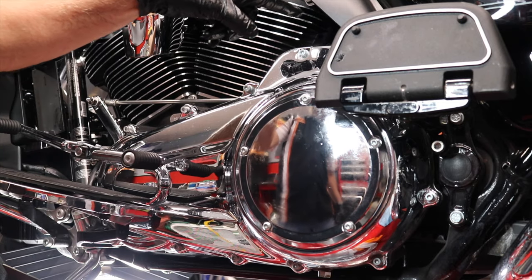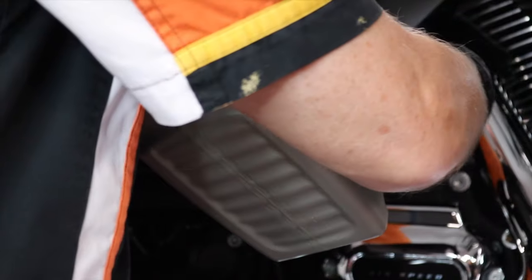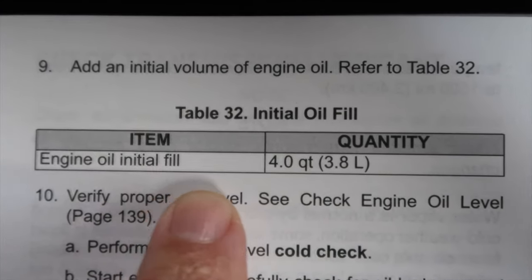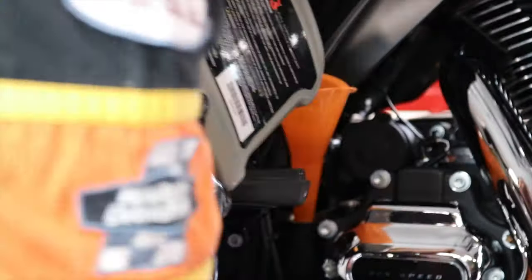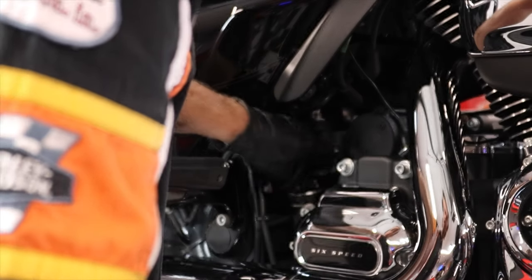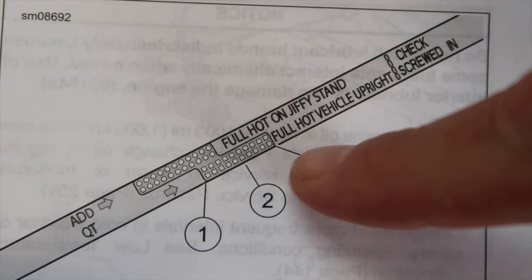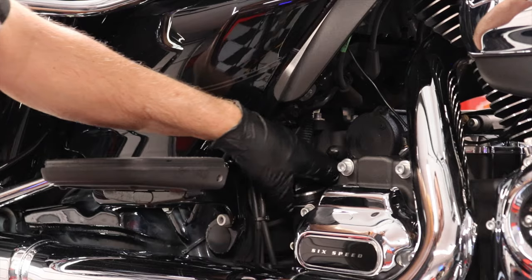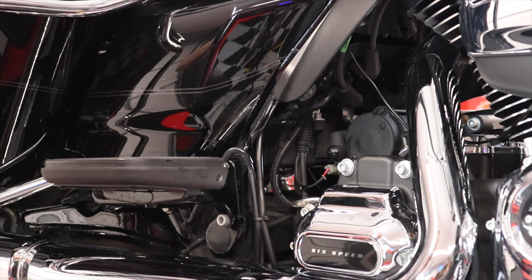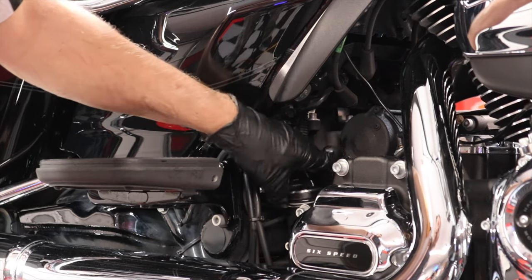Let's walk around to the right side of the bike and add engine oil and transmission oil. My owner's manual says the dry fill for this bike is five quarts, but the wet fill is four quarts, and then you check to get it to the appropriate level. With the four quarts added, I'll do a cold check on the bike sitting upright. On this model you can check the bike upright or on its jiffy stand, and the dipstick indicates the correct level for whichever position. This model also requires checking the oil level with the dipstick screwed all the way in. That looks good for now, and I'll do more checks after running the bike for a little while.